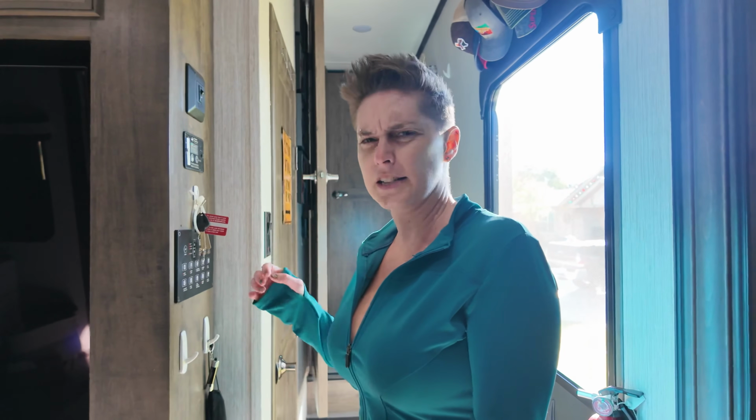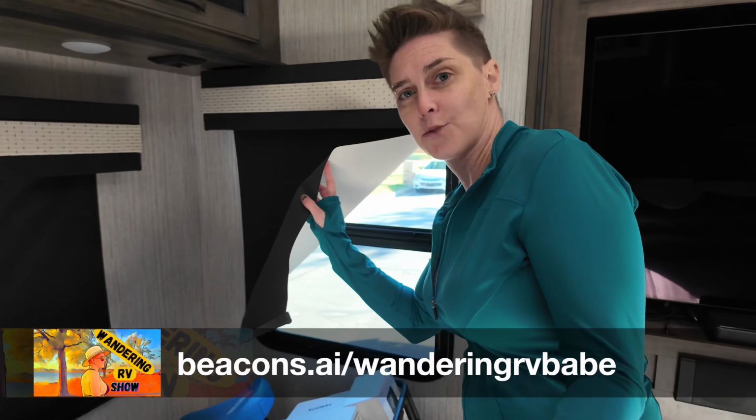Maybe take the opportunity to do a little laundry and use a little bit of extra hot water, you know, stuff like that. I don't know if you can hear the water pump going right now, but we can, and that's always a really good sign that your water pump is working, if you can actually hear it turned on. The very first winter that we had our camper, something froze and then cracked, and the water pump would just keep on running and wouldn't turn off even though we weren't getting any water. So we had a mobile RV tech come take a look at it. They ordered a part and fixed it the next day. It was easy peasy, no big deal. But now we know what to listen for and what to look for to make sure that our water pump is working properly. It's basically just sucking in that bleach water into the whole system.